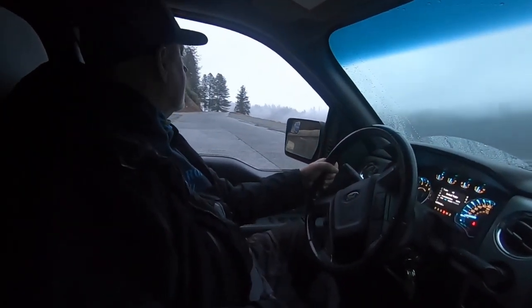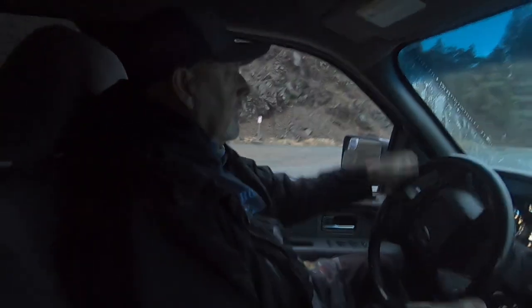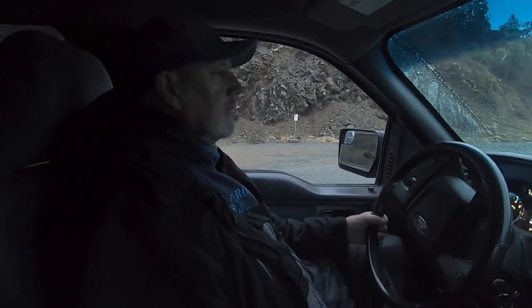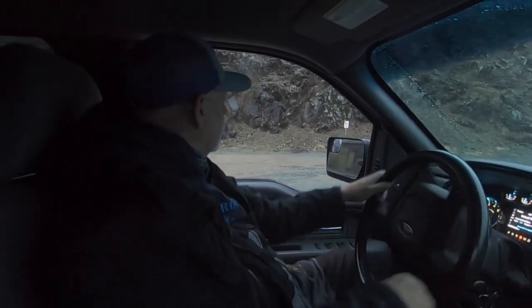What you should do is, once in a while, make it a point to jack up your wheels and try wiggling them. If you've got a super, super light little wiggle to it, then they're okay. If you've got a fairly good wiggle, you should tighten them, because that's what blows the center out of the bearings.